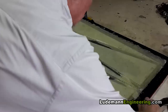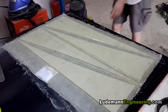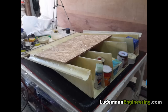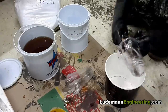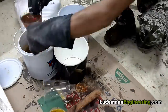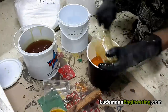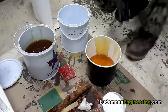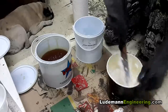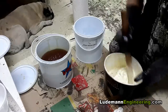Using my trusty spatula around the corners and edges, then the one-meter-long stainless steel ruler, and it pops off. Not shown is where we cut this out on the bandsaw — we cut out each strake and they're glued in place just enough to hold them while we add fillets to all the inside corners. My assistant is mixing up another batch of epoxy, and what we're going to do now is make a putty of epoxy resin and micro balloons. Micro balloons are tiny microscopic glass balloons — like dust — and we mix them in with the epoxy, basically mixing air in with the resin.